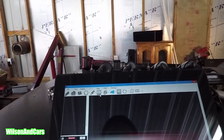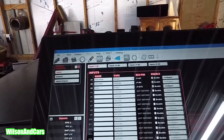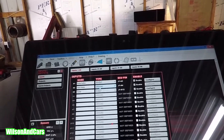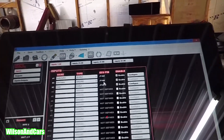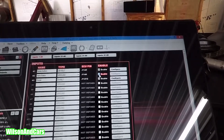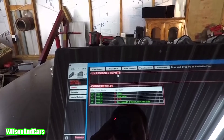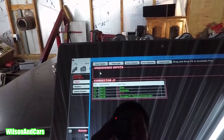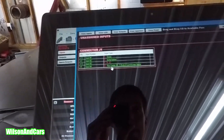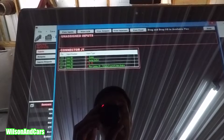We're going to come in and go to our inputs and outputs. On the left you'll see where it says 'Inputs.' Right there, number two, which I have labeled as my trans brake — the type I clicked and selected ground because that's what I'm using. I'm using J1 connector A4 ECU pin. You've got to enable it, so click enable. Then come up to the top, go to your pin map — it'll have an unassigned input area. Take the one you just enabled, click it, drag it down to whatever input you're using. I'm using pin A4, so I drag it down and right there's trans brake, marked G for ground.